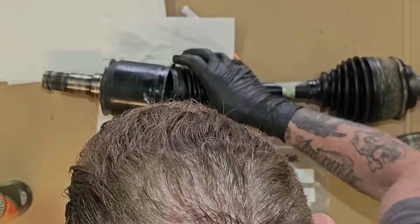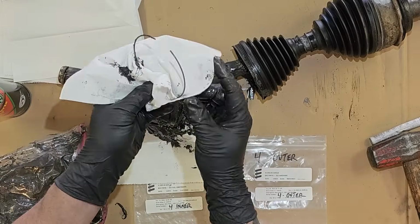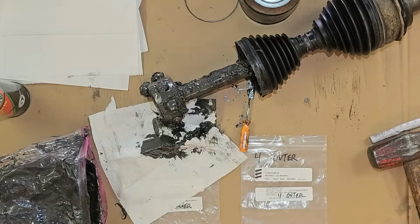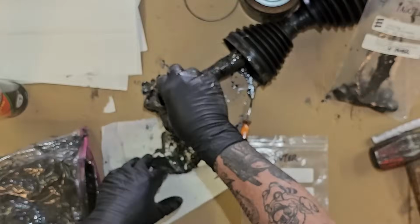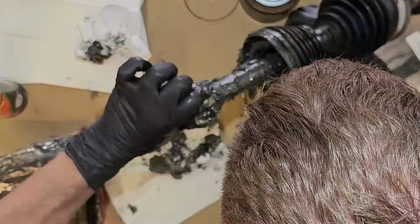So for the CV axles, I had a couple choices. I could get custom axles made for $2,200, or I could buy 4 used CVs off eBay, cut them, weld them together, and then be done with it. If you guys have watched my channel before, you know this is a budget-minded channel, so I went for the eBay special. I did make sure they were Toyota factory CVs though, that was very important.